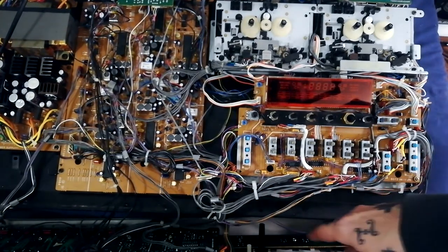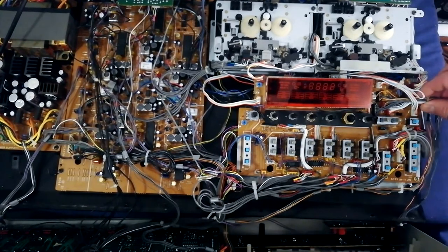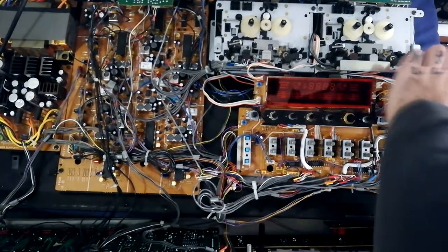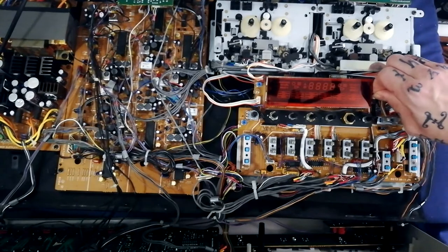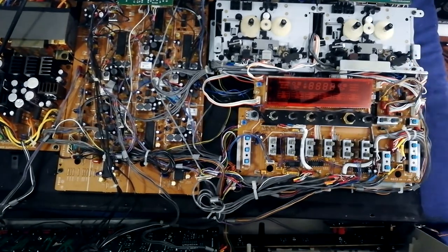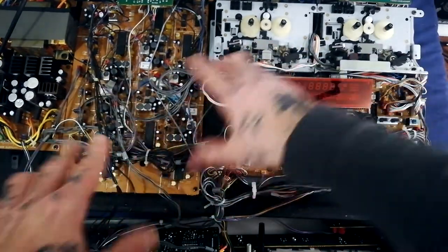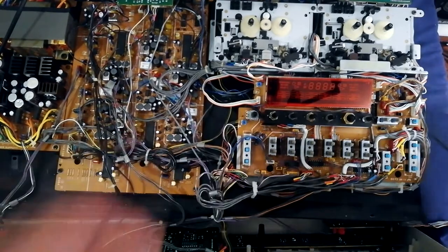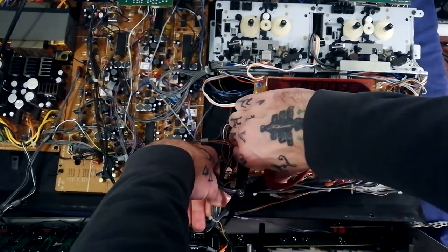There's a daughter board down here with tactile switches and transport controls. Cables are running along here and joining up with cables running under here, presumably to the transports. There's a cable tie so I'll probably replace that on reassembly, but for now I'm going to cut it - just putting the tip of sharp scissors in there, hopefully cutting it without cutting any wires beneath. An orange and grey wire is going to a two-pin header, and all grey except one blue wire goes to this black header. Cable ties like this are important for getting cables into free space inside the unit, but they're pretty obstructive for seeing what goes where, so I tend to cut them to get a better impression of what's happening - you can always replace them, they're not expensive.